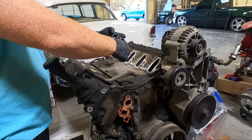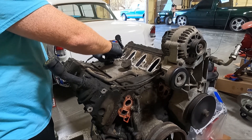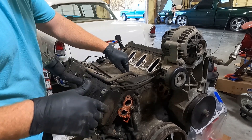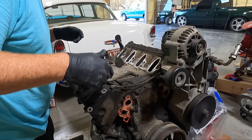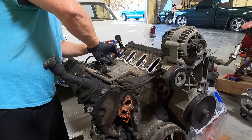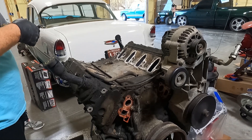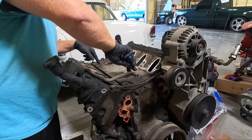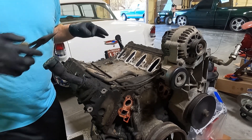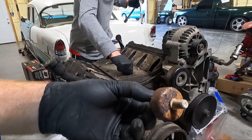We're going to move on to the knock sensors, which I'm sure are complete toast. We're going to throw this harness away — we would never reuse this, especially since it didn't have air or anything. A lot of times they break; this one broke the minute I took it off. Pretty common. If you have a pair of needle nose pliers, a lot of times you can just pinch them and they'll come off. We're going to throw that away. I think it's a one-inch socket to get the knock sensors out — we will also be throwing those away.